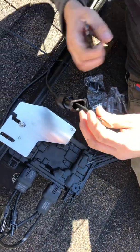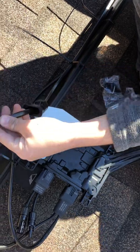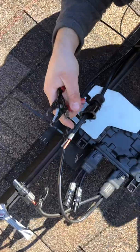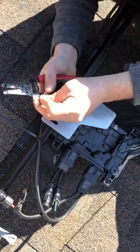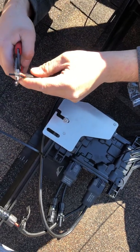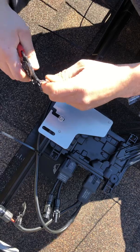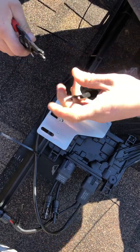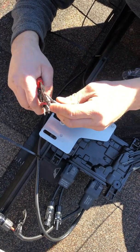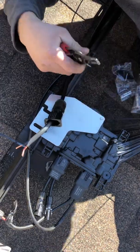At this point I'll put these together and shorten them to about here, then cut that off. We're going to strip both ends. I'm going to use the 12 setting because this is 12 gauge wire — strip about that much. And again use the 12 for stranded.